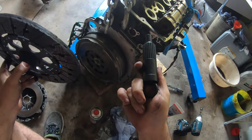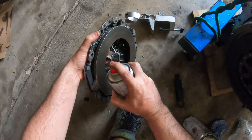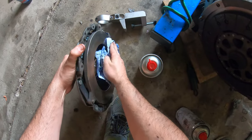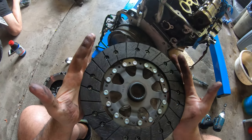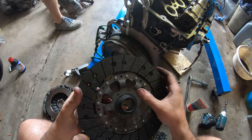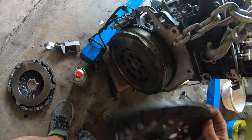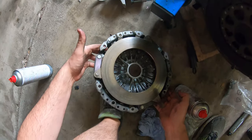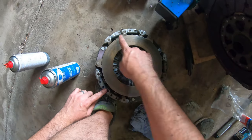And we'll put it on with our clutch alignment tool. This is $20 on eBay. So you need to face the clutch up. This says Getriebseite, which means transmission side. So I think it sets down that way. I don't think it would fit the other way anyway. So transmission side, how does this go on? There are three dowel pins. So I'm assuming that's 1, 2, 3.